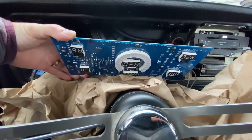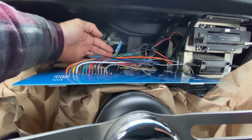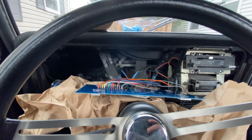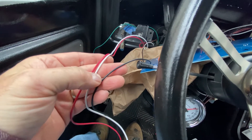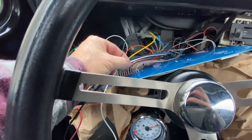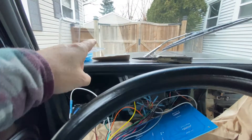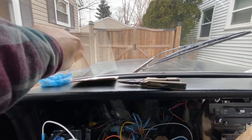I've got the Intellitronics unit here and I'm just going to start connecting these wires with the butt connectors. I have the wire map written down which I'll share in the comments below once I'm 100% sure. There are three wires coming from the new speedometer sensor: red is positive, black is ground, and white is the actual sensor — this white goes to the white on the new dash. We also ran a green wire for dimming, which goes to the parking light up at the front left fender.